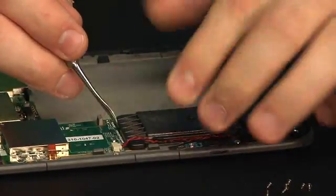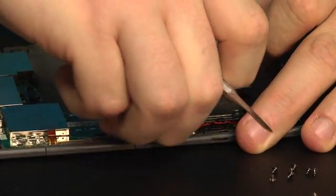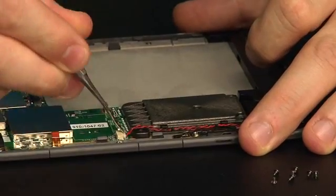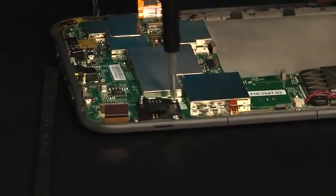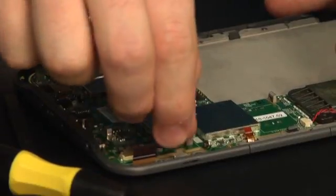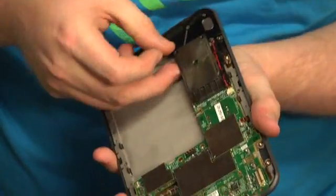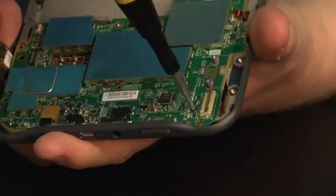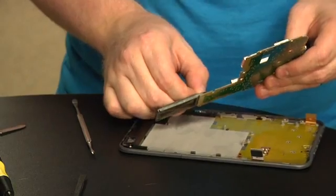If the speakers stop working, I'm not going to be heartbroken. Why does the Kindle even have a speaker? The Kindle has a speaker because it can play MP3s and audiobooks — it can text-to-speech some books if the publisher allows it. The last thing I'm going to do is take off these four screws on the hinge power connector, because I think that's probably holding the motherboard down. There was one screw right here that was completely invisible to me. Gently sliding out — I heard something pop there, that's usually a bad sign. Release the speaker cable — so this is the motherboard.